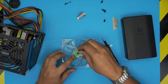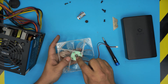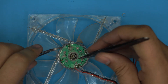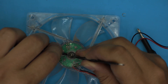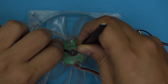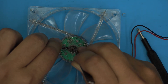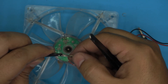Once we remove the rubber at the bottom — you might have a different type of cover — we're going to see the fan shaft. To remove the fan, there's a little C-lock on it — it's a white plastic piece with a cut in it that holds it in place. We need to open it up and remove it. Grab some tweezers — we're going to find where the cut is and open it up. That's how you remove it: it hugs the shaft through that cut.